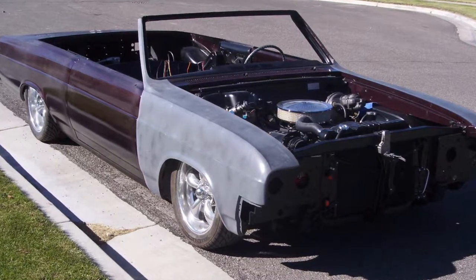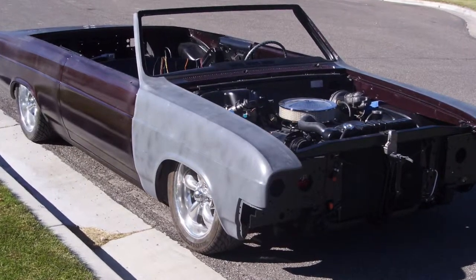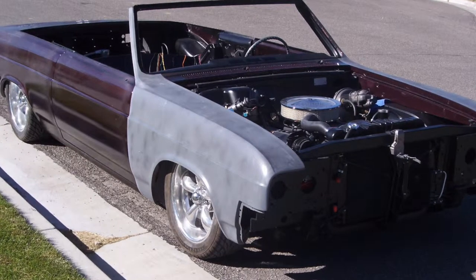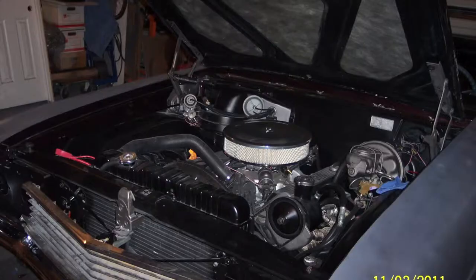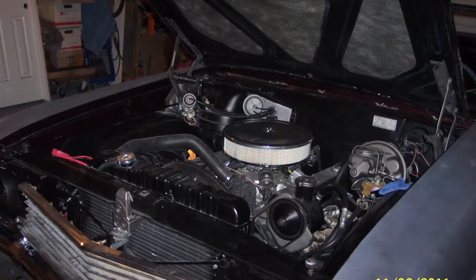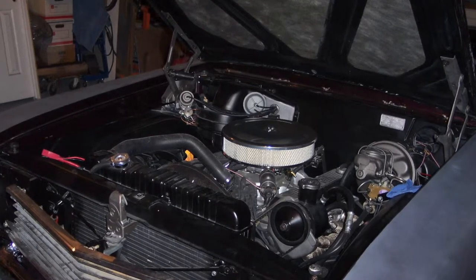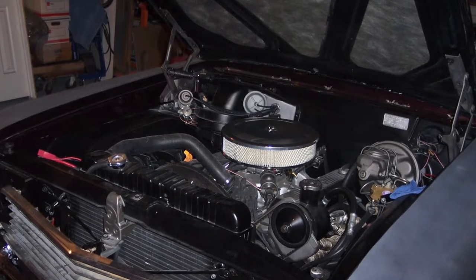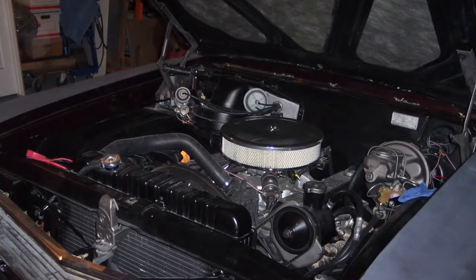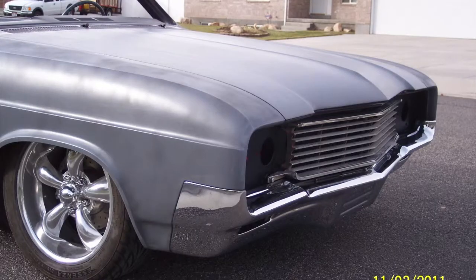This time I've decided I'm just going to leave the jams, the doors, and all of the area around the trunk lid — leave that area, mask it all off, take the risk of getting overspray and just take extra care polishing those areas if they do get any overspray. One of the nice things about doing it this way is if I'm putting the front clip and hood on and end up chipping up the edges of the doors — which I did — then it's easy to go back and fix, touch those areas up, smooth them out, and put on the final coat of paint.